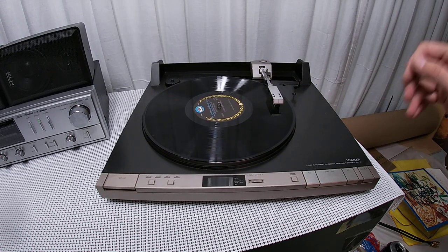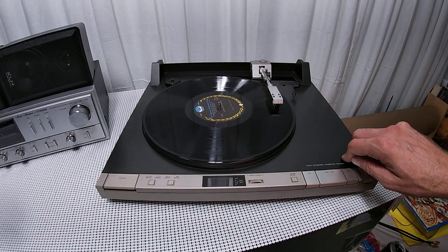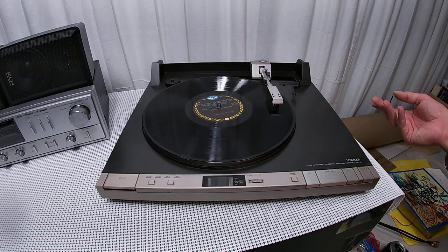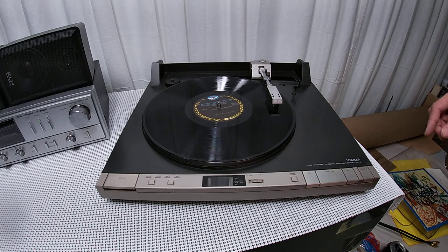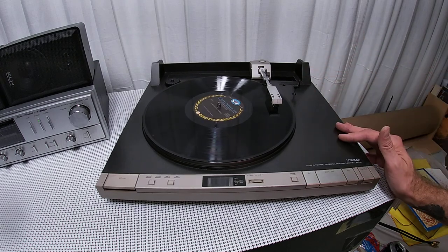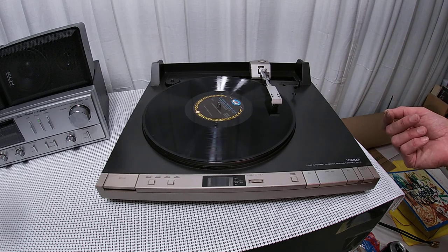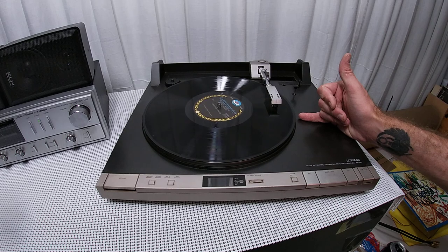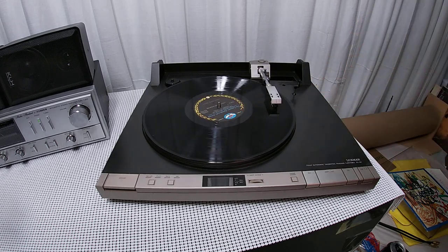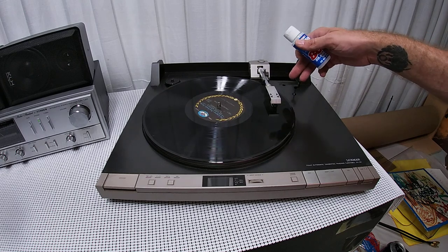My review of the PX-101 is that once you get it dialed in, it's cool. But records vary somewhat, especially once you get to warped ones — you can see this one's kind of off a little bit — and this thing is really sensitive to that. As a result, I've found it sometimes not returning, sometimes it'll get confused as to where it should be and what it should be doing. The drop point is okay, it's fairly consistent as long as the tone arm stays still. I'm wondering if the tone arm shouldn't have some of that really thick oil — the oil for the tone arm drop — because this one was dropping like a rock.